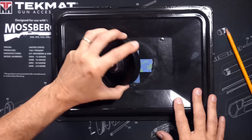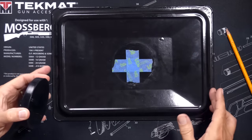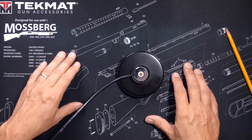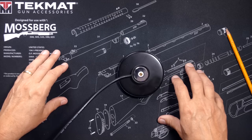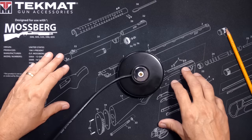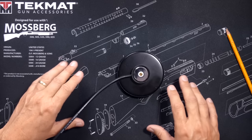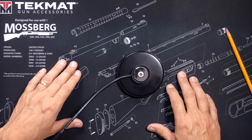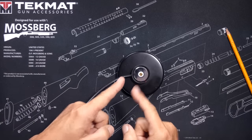But what if you desire to mount your mobile antenna on a corner of your vehicle with no metal or ground plane directly below it? Or what if your goal is to mount your GMRS antenna on the fiberglass roof of your Jeep or motorhome? Or maybe you want to use a mobile antenna with a base station in your house, nailed to a 2x4 in the attic, with no ground plane below it? In situations like these where there is no adequate ground plane, you will likely get a very high SWR, and the antenna would not perform to its full potential, resulting in fewer contacts.